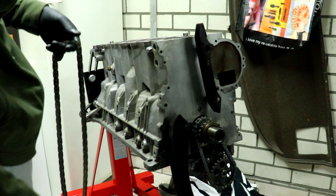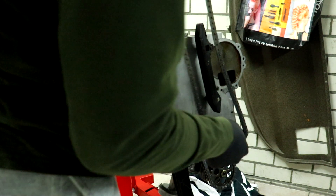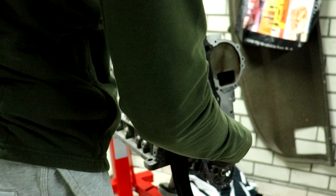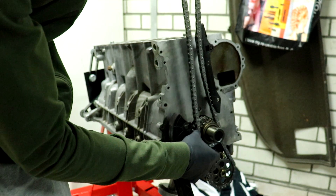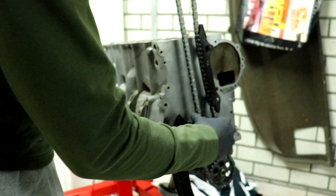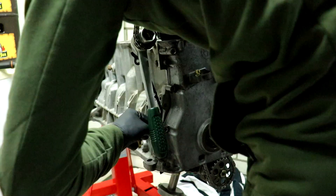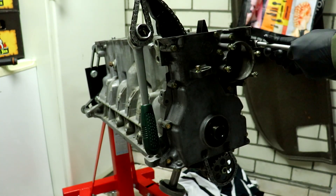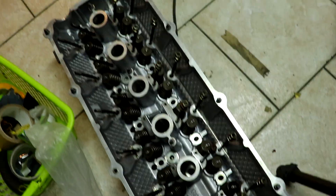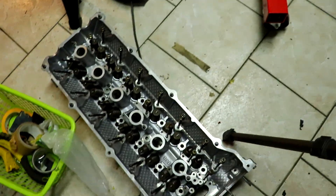We needed to wait for some parts - I got the new timing chain here and the guide pin. I had to take the timing cover off but all good because we got a new chain, so we're gonna put that on. Then we can put the timing cover back on. And you know what time it is - it's time to put the head on. I'm gonna grab the head gasket, put that on, and then we can put the head on.